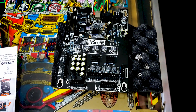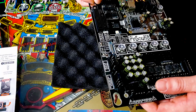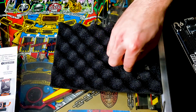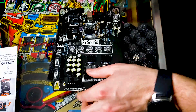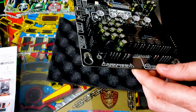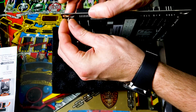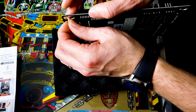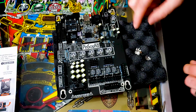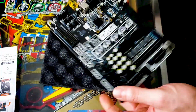What we're going to have to do is get a screw into this top one right here. But before we do that, we need a washer. This is where it's going to take some agility, guys. This small hardware like this. So washer into that hole. Now we need to use the spacer, and the spacer is going to go on like that, and that's pretty much finger tight. Now I'm going to do it to this side over here as well, so I can install the top one all in one go. Alright, so I've got my screws and my spacers on my top portion.